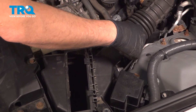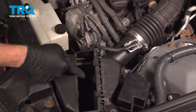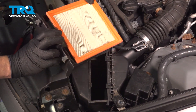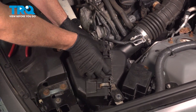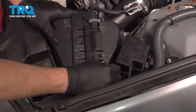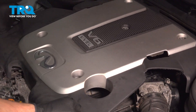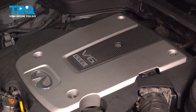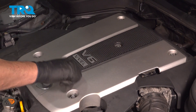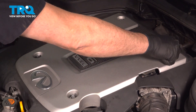Go down to the sensor and install the harness — press it on and you'll feel and hear it snap into place. Install the harness retainer on the side. Now install the air filter — this is a perfect time to replace it if needed. Simply pull it out of the tray, replace it, slide the unit down inside, and press down the retaining clips. Install the airbox retaining bolt and snug it down. Place the engine cover on top, lining up the two studs — the remaining hardware will line up itself. Grab your hardware and get everything started by hand: two nuts on the front and the remaining three bolts. Once started, gently snug them down.